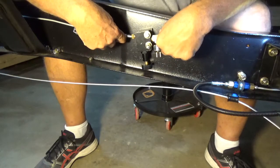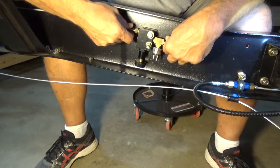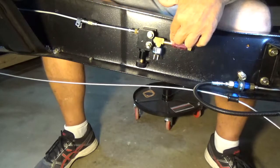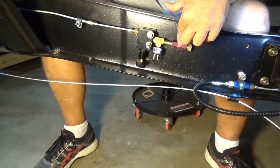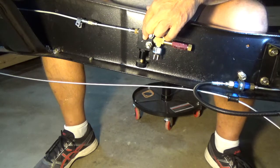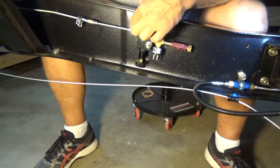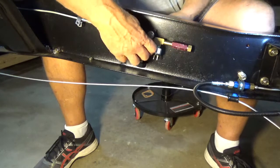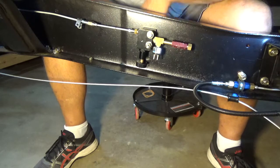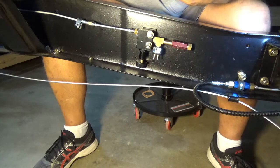What I tend to do is leave my brake lines a little loose, and that allows me some flexibility in connecting the brake lines together. This system has the residual check valve, junction T with the stoplight switch, the adjusting proportional valve, connected to my rear steel brake lines going to my rear drum brakes. The next thing to do is connect that flexible brake line from the residual check valve here to my master cylinder.